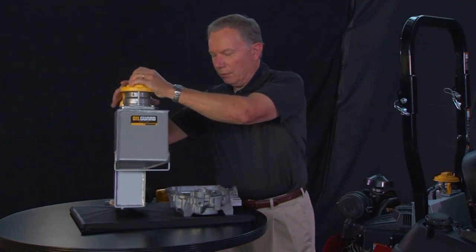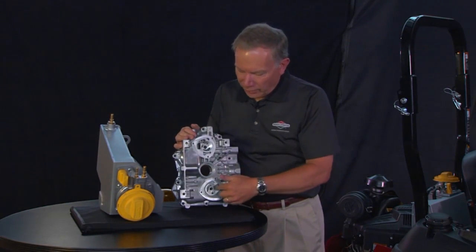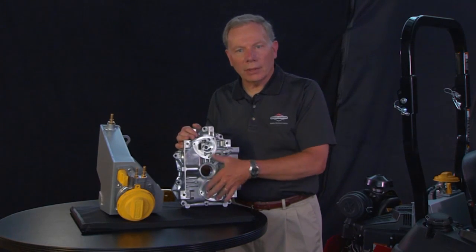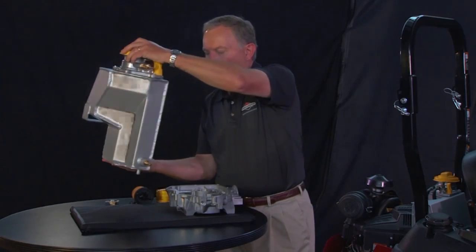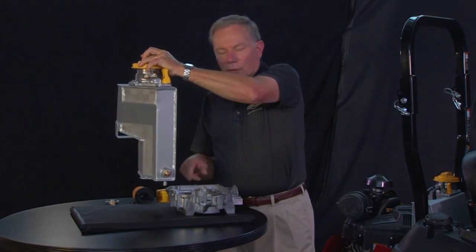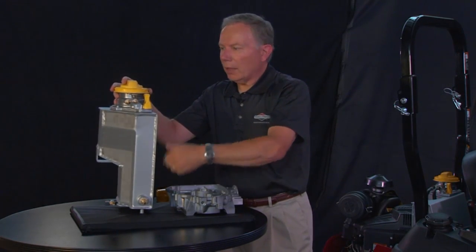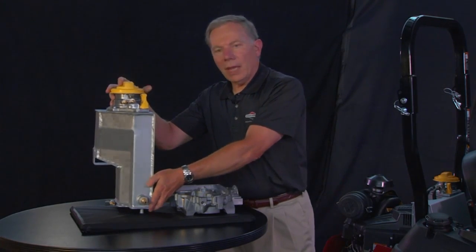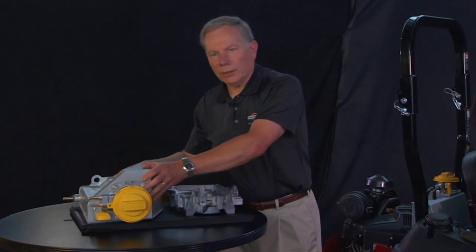So what happens is, to make this work, how does the oil get from the engine back and forth? We very simply added a second pump, same parts, just a little smaller capacity, to the engine, so it now has what we call a scavenge pump. The oil goes by gravity out of the tank right here and goes through the engine and then is pumped back into the tank, where it circulates back, goes through the filter and circulates back down. So that is the basic concept of how a dry sump system works.